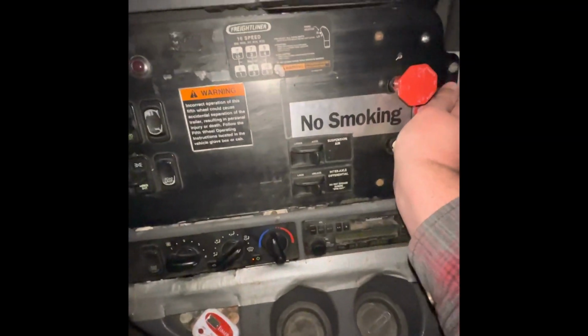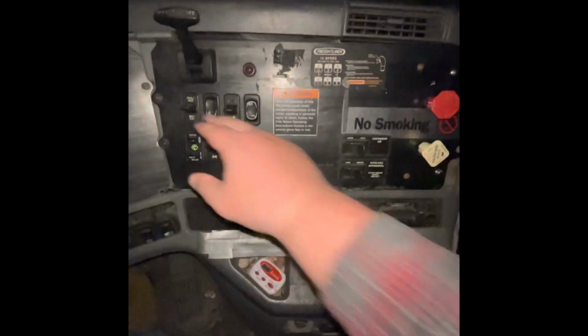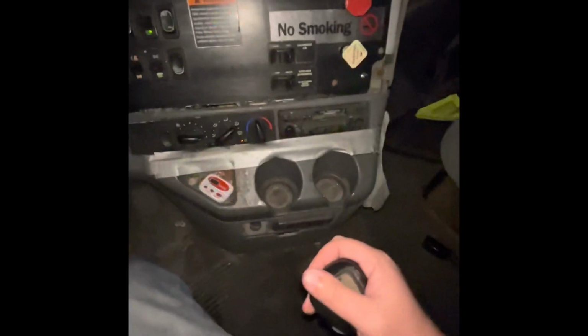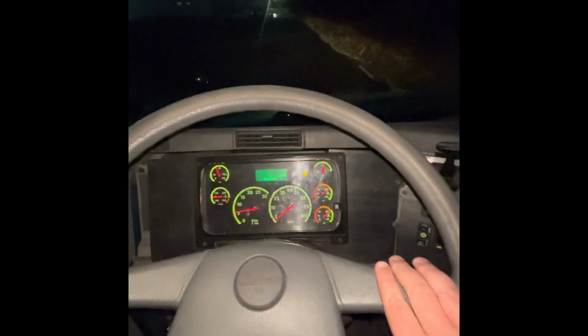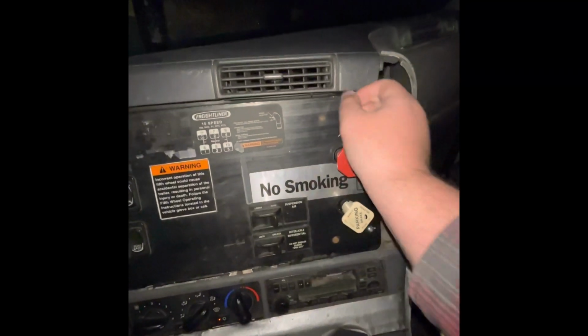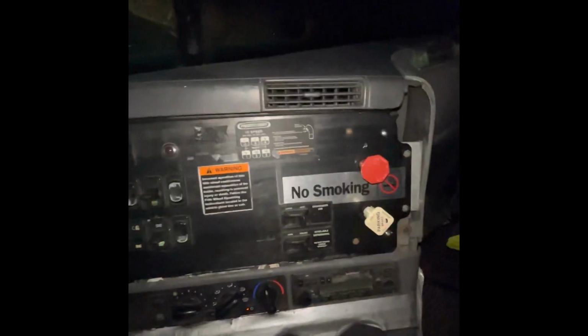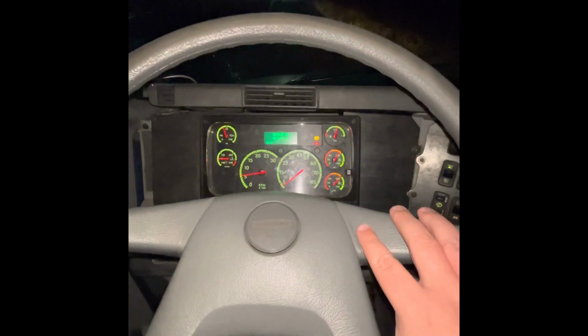What you wanna do is push in the yellow valve. I'm gonna shut my cruise off, put the truck in a low gear. Now I'm gonna do 2 light tugs with the clutch. 1, 2. Now I'm pushing out my yellow brake and I'm pushing in my red one. I'm testing out my tractor brakes now. Red was my trailer, yellow was my tractor. 2 light tugs. 1,